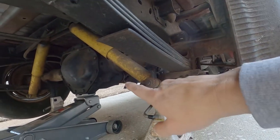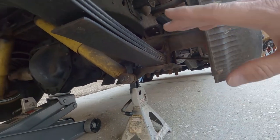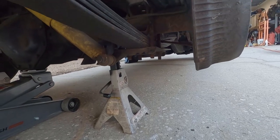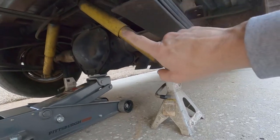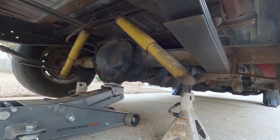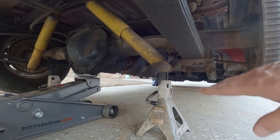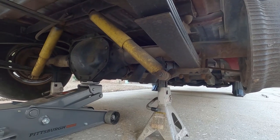You're going to need an angle finder and a welder. Once you find your pinion angle, go ahead and weld it up — just a small weld on each side around the perch. The shock plates I used put a heavy angle on the shocks, but that was the only way I could do it with the space given. If I ran them straight down — which was closer to the factory position — there was more room for travel, but this way worked with the geometry I had.